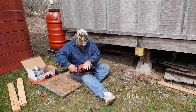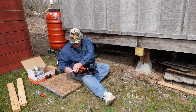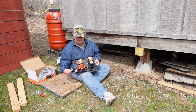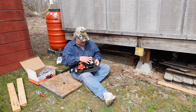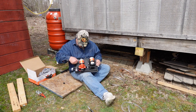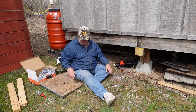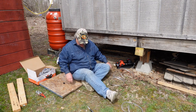I can now get into the pump part. I want the outlet pointing down. Water comes in from the barrels, goes to the strainer, through the pump, into the accumulator tank, then out to the faucet. Very easy. Now I have to crawl underneath and decide exactly where it's going and what I have to do to mount it.